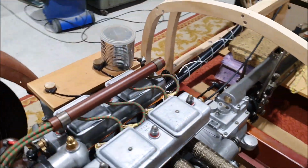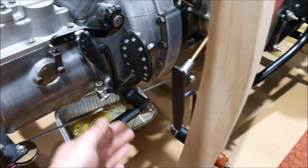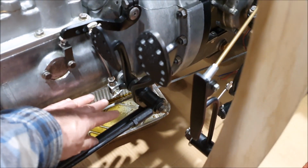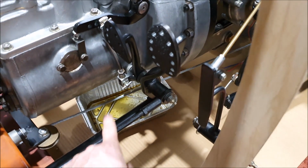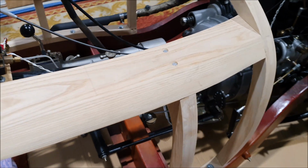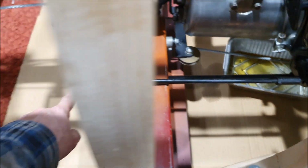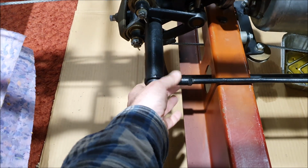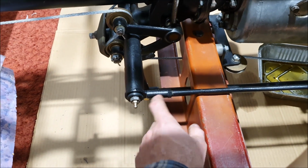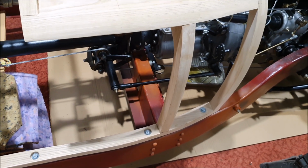When I do the floor at the front, it gets very tight in here around the pedal area, and I think what I'm going to do is the floor will actually have to have heel troughs in it, sort of one here for the accelerator and brake and one over this side for the clutch, with a sort of piece in the middle which is for the foot brake linkage in the middle there. That's the stabilizing rod. You can see here, this one down the bottom here is the actual linkage for the brakes, but because it sticks out so far, you've got this here to help stabilize everything, and that needs to be straight. If you tried to bend this, it would be springy. It wouldn't be under tension, so it has to be a straight line. Another one of those little details.